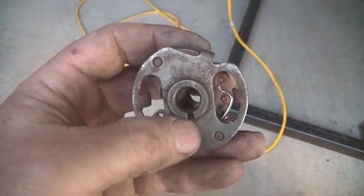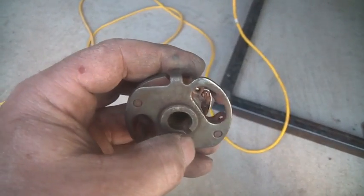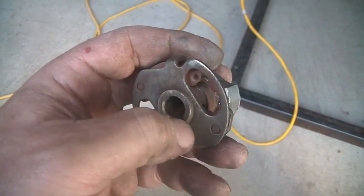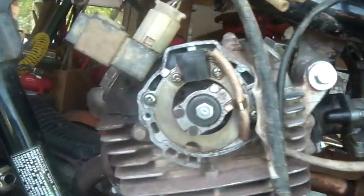If you look at the camshaft you'll see a little notch on it, or a little key - a little pin sticking out. What you've got to do is slide that pin right in here. A very common thing to have happen is that little pin falls out and falls into the engine.